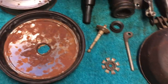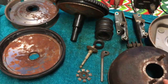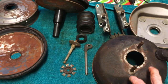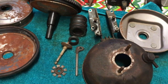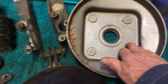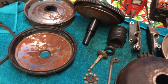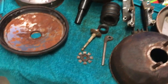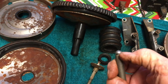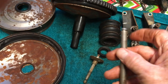I soaked the band in a little bit of vinegar to clean it right up, and I'll repaint this stuff — what have we got to lose? After speaking with Brendan — this is a Midland brake booster — he thinks if need be we can replace it with a Bendix unit, since some of those cars had Bendix brake boosters on them. We're going to try to clean it up first. I think I can even buy one of these little dog paw rods on Thunderbird Headquarters. It needs a new plastic retaining piece, but it's not that critical — it's just there to keep it from falling out — and we can put an O-ring around it.